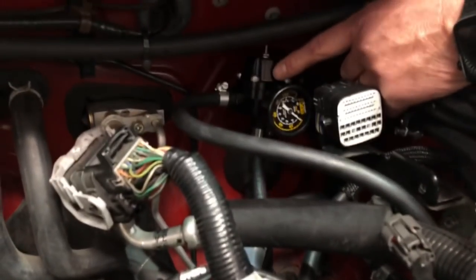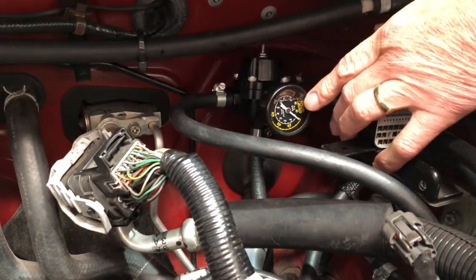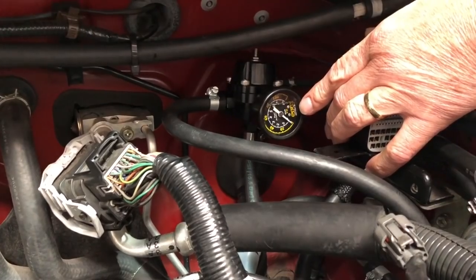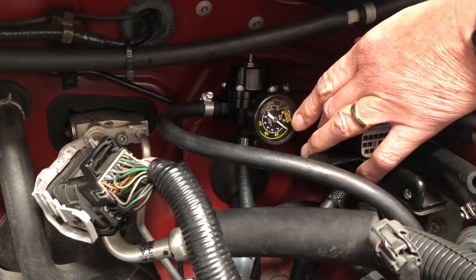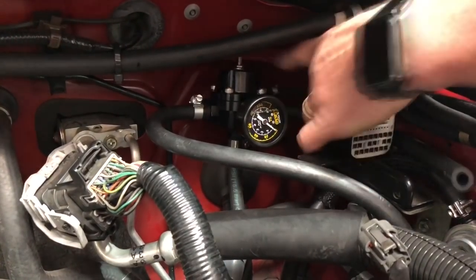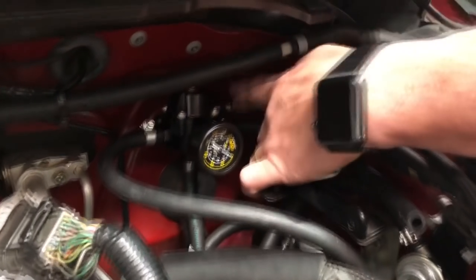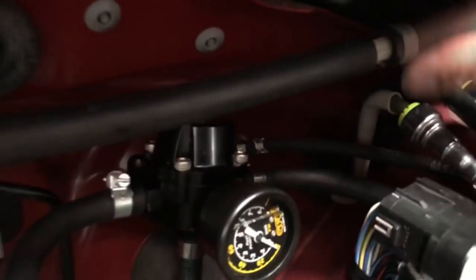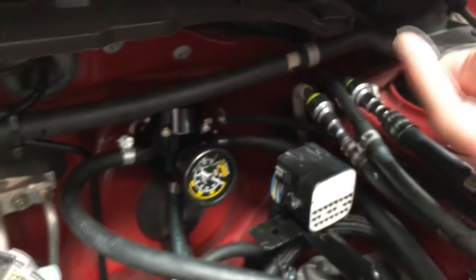One of the things you'll notice up the back here — we're now running a GFB fuel pressure regulator, which you'll notice has got a fuel pressure gauge on the front. That doesn't add any features from a performance point of view, but makes things a lot easier when we've got it on the dyno so we can check fuel delivery when the engine's under load. It conveniently bolts into the firewall quite neatly on the back of this model. You'll notice how it's got several lines coming out of it — some for the vacuum reference line, and also one for the fuel supply and the return.